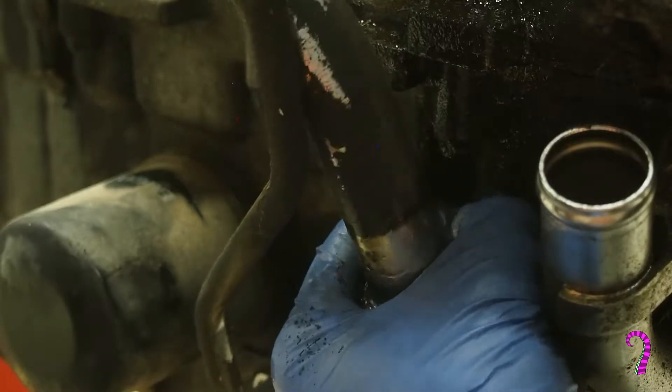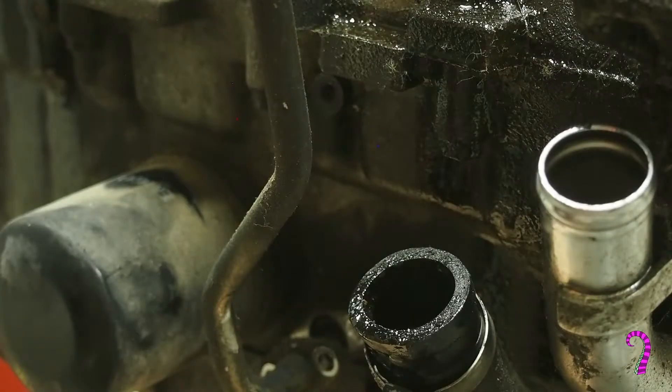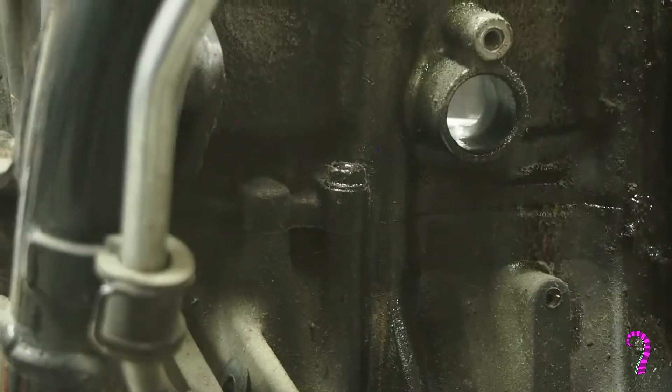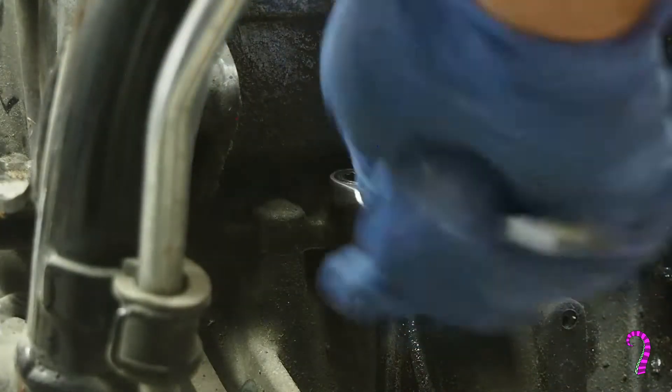So that'll be the name of the game today. I'm going to start by removing the cylinders off the bike. For these bikes it's a little bit weird — there's one kind of silly little bolt there that holds the thing on. I guess you can make the case it's there to save your gasket if you just want to do a head gasket and you don't necessarily want to disturb the cylinder gasket. This bolt might be a way to preserve that cylinder gasket.